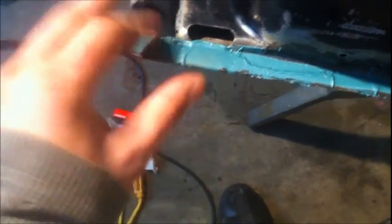Okay, it's been about 10 minutes and it's still a little tacky, but I can scratch the surface. I can almost scratch it right off. Am I supposed to be able to do that still? It says 5 to 6 minutes it should be set up. That probably means just to sand it. I'm wondering if I didn't use enough hardener. See what you guys think.